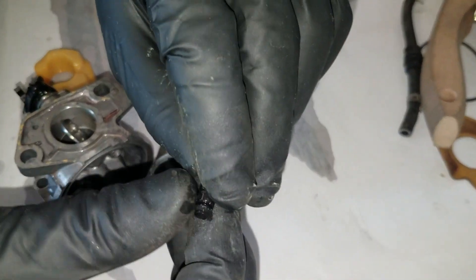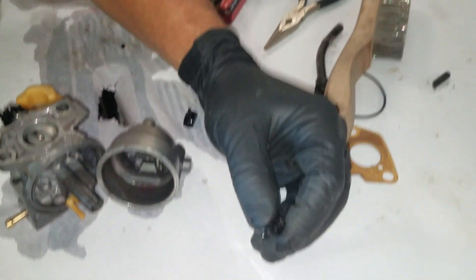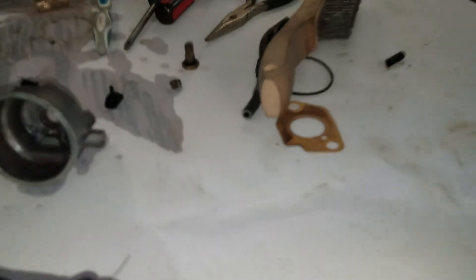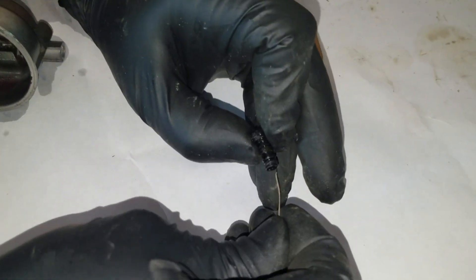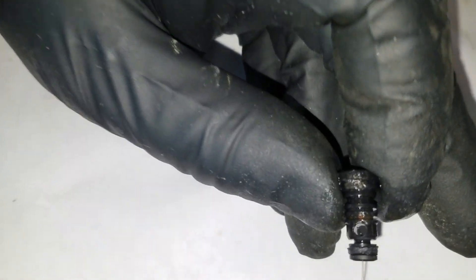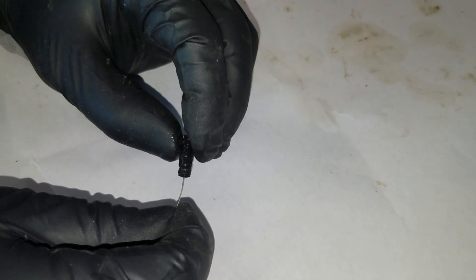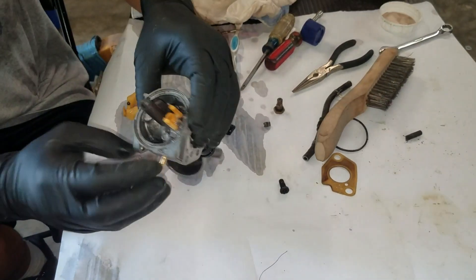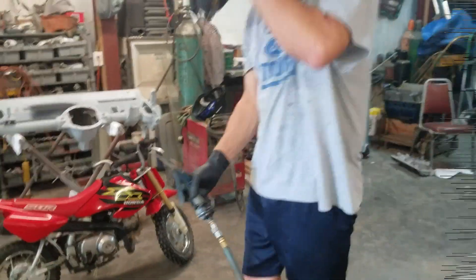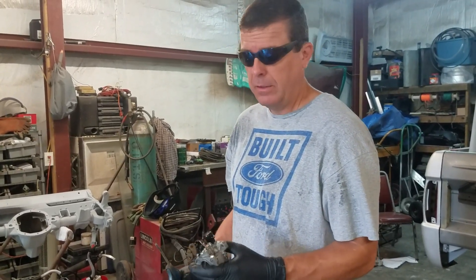This is our low side circuit — basically the idle circuit. We want to make sure this thing is good and clean. It's got a little hole right down the middle of it. This is plastic, not brass, so that's why it'll stay black. There's a hole on the side — I can take this little wire and once I push it through, I can see the wire come through the hole. We know the hole is clean. This piece is good. As far as the carburetor, I'm just going to use compressed air and blow everything out really good. Remember: if you're using this stuff, use safety glasses because you don't want that soap or carburetor cleaner in your eyes — let me tell you, it burns.